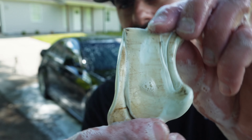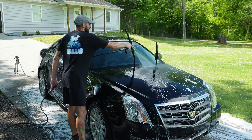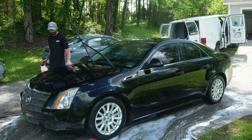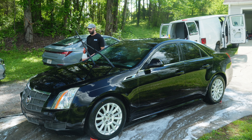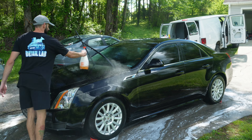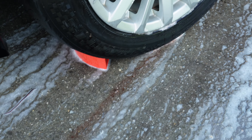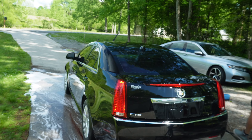I just finished up and that is what came off the back bumper. Now that the clay bar process is done it's feeling a lot better. I'm going to spray on my iron remover and get any embedded iron particles out of the paint. I'm going to do the wheels too because they were pretty bad. I'll let this dwell for a few minutes — it's hard to see on the paint but you can see it running off the vehicle, and that's all the iron contamination coming off. I'm going to go ahead and spray off this iron remover.